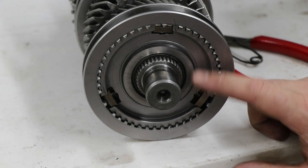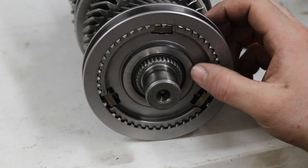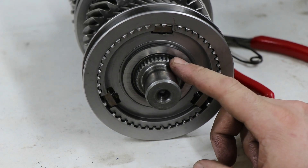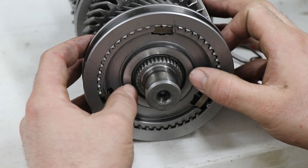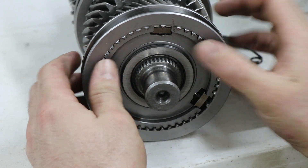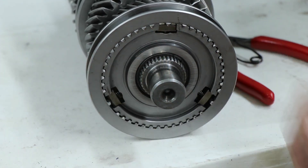Just to confirm your third gear snap ring, which is just inside of here, this is the thrust bearing race on the outside of it. So that snap ring should go on there, snap in, and then it should have just a little bit of press fit so that you kind of have to force it. But this race, which is just flat on both sides, should snap down tight over the top of it and be held in there properly so that it doesn't fall out.